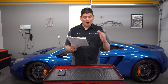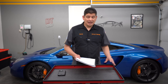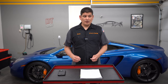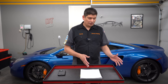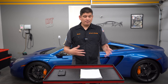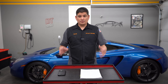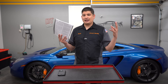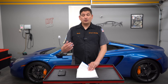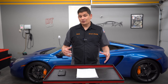You're going to want to read front to back — it's a hard pill to swallow, but once you do that you'll do the questions, and whatever you get wrong you'll go study. If you need more information, use YouTube. If you've never worked on an AC system, go shadow someone: go to a shop, watch them repair and remove a compressor, put it back in, evacuate the system, recharge it, measure it, put in the correct oil, install the belts. Once you do that, when you're reading everything it's going to make sense. If you've already worked on AC systems, reading this will reinforce what you know and teach you deeper details about what those systems consist of.